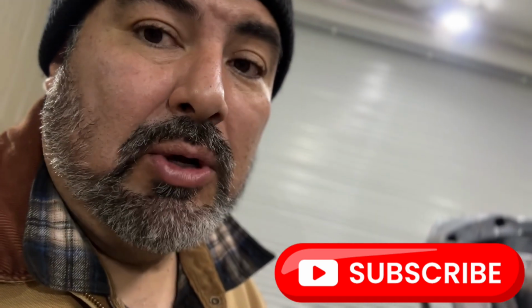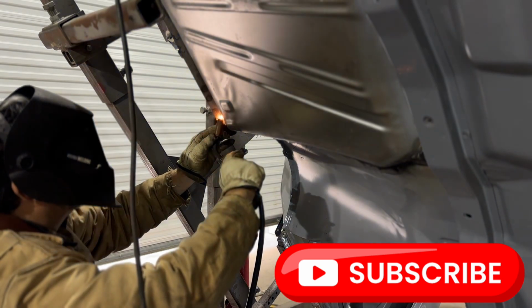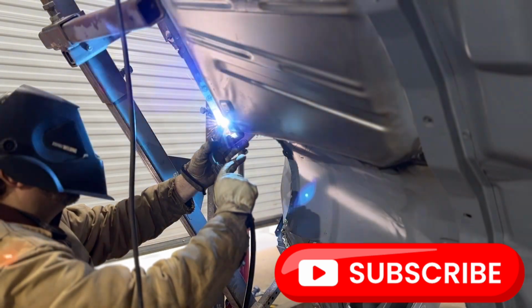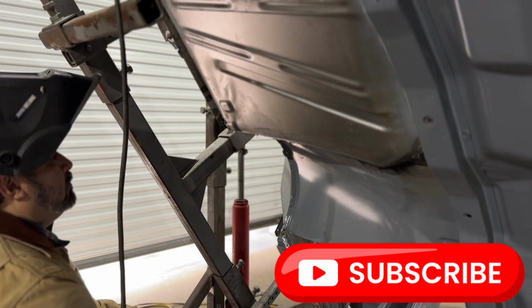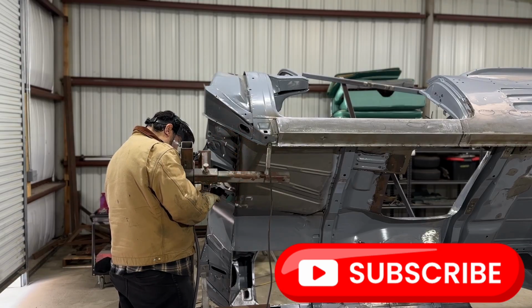So that's what I'm doing before we go home. I didn't talk in the morning because I just wanted to get in here, other than showing you the downed trees in my neighborhood that almost hit houses because of the storm over here. But that's the only time I talked in the morning. When I got here, I got straight to work to get it done. I want to get as much of that floor on this side in as possible. I'm realizing now that the floor hangs down past those inner rockers, so I'm going to have to get some primer on them, some rust protection, before I start installing all these floors.